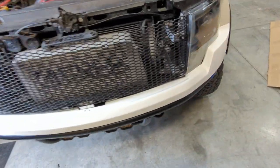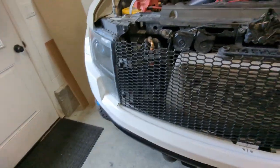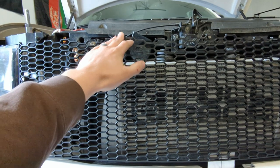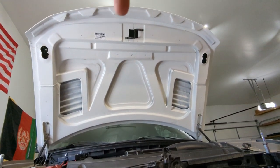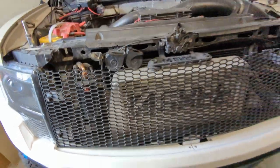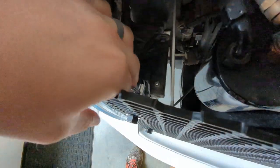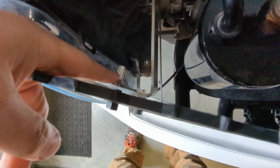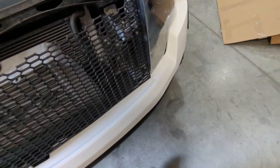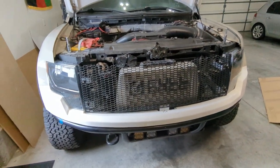I got the top brackets in using basically the same methodology as the bottom. I think it's coming together pretty nicely. I have it all trimmed. It's not exactly level right now since I kept it a bit high where I could — there are some little teeth things there — but I don't really care how it looks with the hood up. Everything's looking pretty well and straight. I also found some 7/16 low-profile nuts to use as spacers in there, and it seems to work a lot better than having all those washers. I might secure them in somehow or I might not — I don't think I'll be taking the grill off that much, so maybe I'll just leave those nuts on there loose.